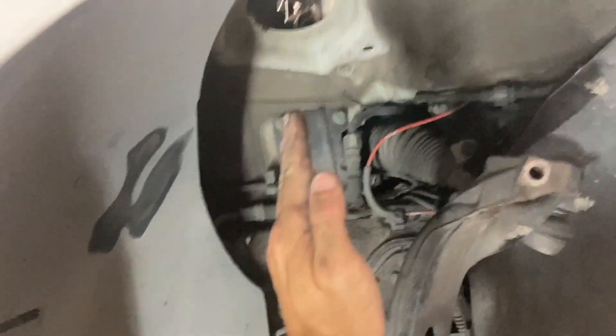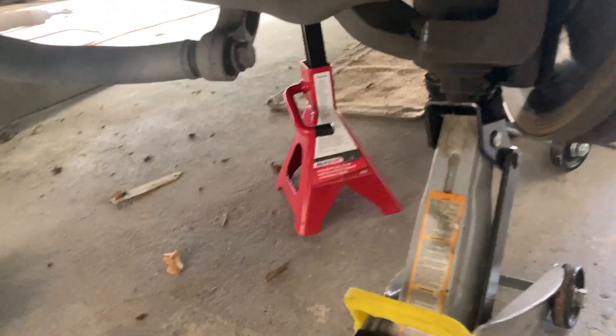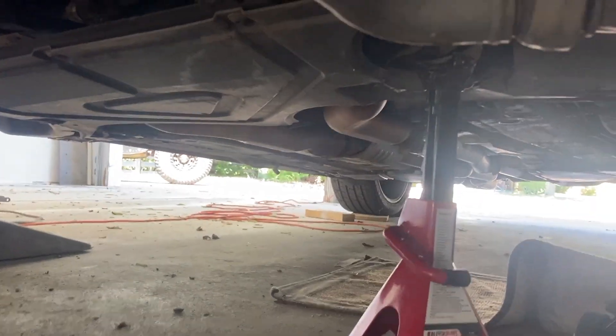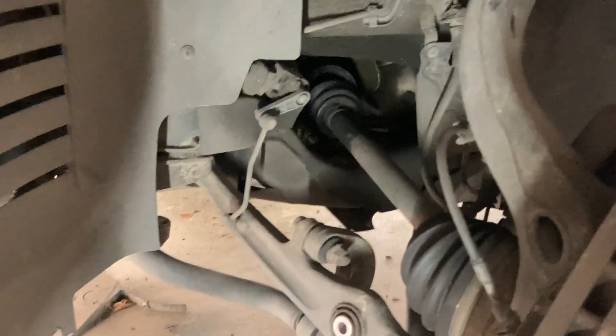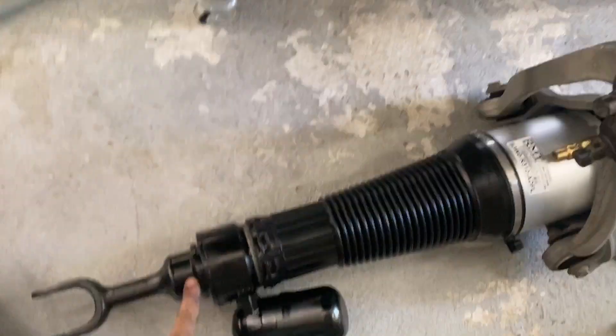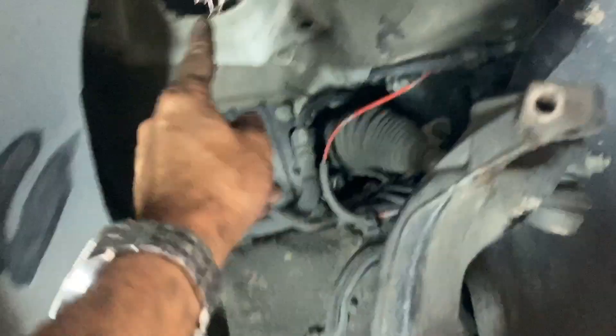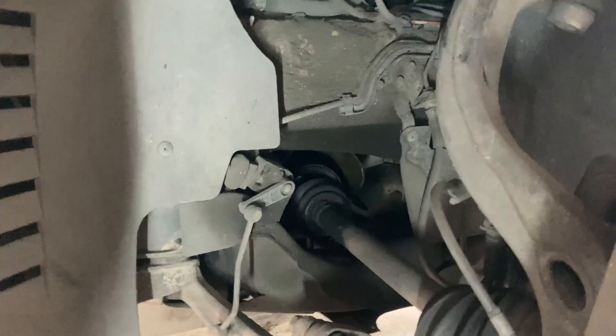Once that happens, this whole assembly is going to want to come in this direction, so be ready for it. I'm supporting some weight with a separate jack — this is definitely a two-jack operation. One jack is on the lifting point and a second jack stand is under the control arm, which I don't want to lift from because it's cast aluminum, but it's better than having the car fall. The second strut will be longer than the failed strut, so I'll need to drop the control arm a little to get enough clearance for it to fit.